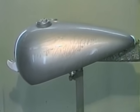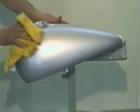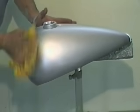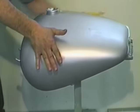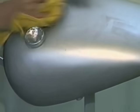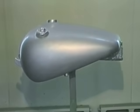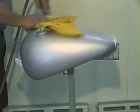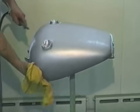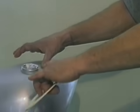Solid color white and black base coats and other solid colors with no metallics or pearls can be sanded, but with metallics or pearl top coats, if you sand a pearl directly you will put scratches in the platelets and literally ruin them — they have to go back to base coat, you have to begin again. We use care not to touch the painted area with our bare hands. It's important to avoid laying on it, because the transfer of oil from our skin can sometimes affect recoats.